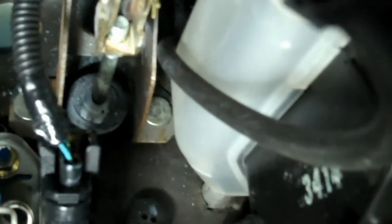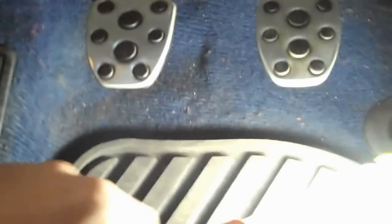What's actually pushing your clutch through the firewall is right above your gas pedal, not your clutch pedal. So you get in there with some white lithium grease and you should be good to go. If it's still making noise after you grease and clean it out, just leave some comments. That's where your arm goes into the firewall — I moved that up and haven't had any noises in a really long time.